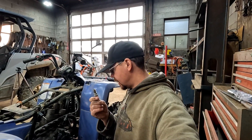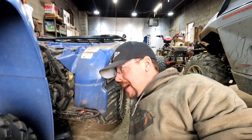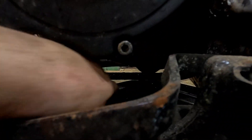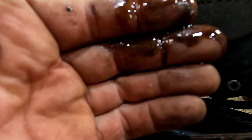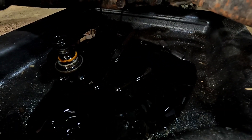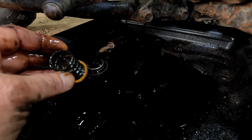The drain plug for the oil was so tight I had to get an impact to spin it off — quite a bit scary, but it popped loose. Let's see what the oil looks like. It's been a while since this drain plug's been off. There's probably a little screen filter in there — yep. It's a little dark, a little old, but it is not awful. I wouldn't have been scared to start this with that old oil in there. I'm not seeing any huge metal flakes or anything. Just some old gasket maker — nothing dangerous looking on the screen. The oil is pretty good in this guy.